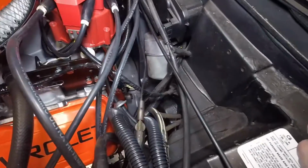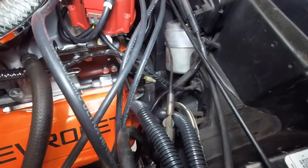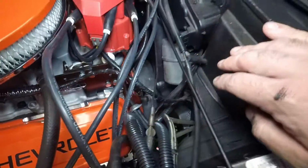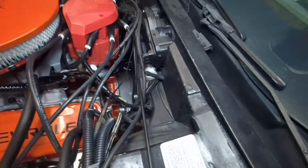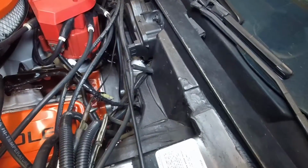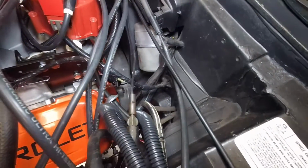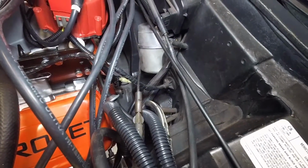Alright, so while I wait for David to help me with this exhaust, I'm going to tackle these upper bell housing bolts right here. I got this one and then there's one below it. I'm not going to take that last bottom one out until we're ready to drop the trans. That should be enough to hold it. Plus the trans jack is supporting the weight, so yep, reach in there with a long 9/16 and break them bad boys loose.